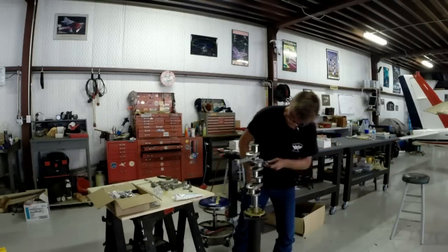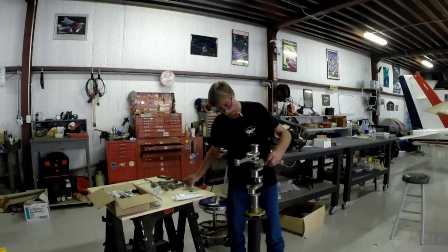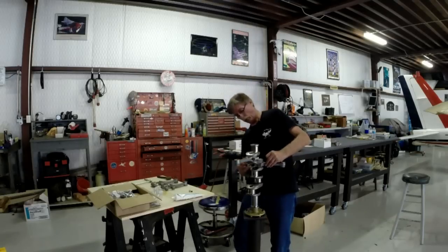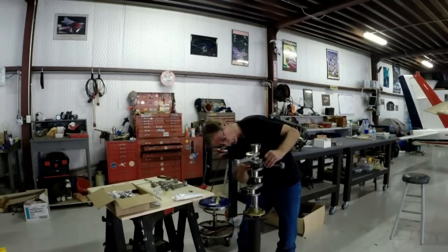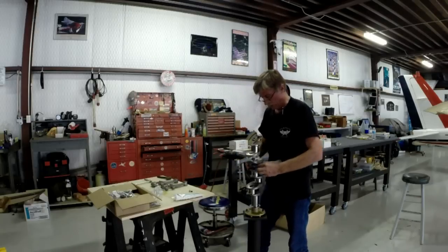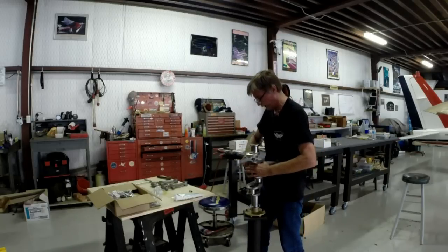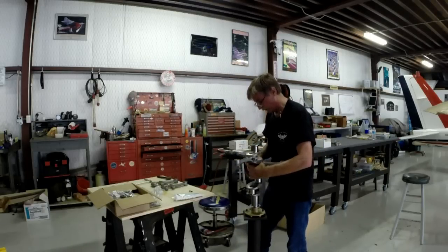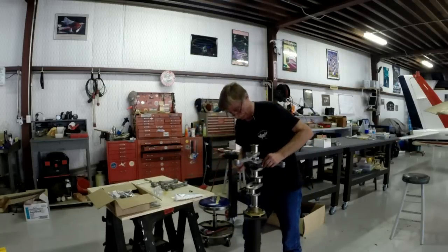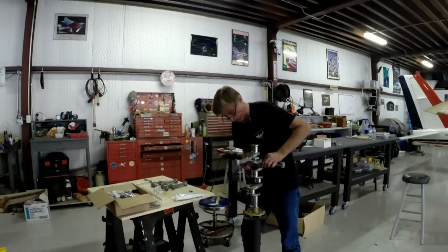1-1. This is 2. And 2, making sure all the cap ends line up. Like I said, those numbers are on that side for a reason. Now I'll try to cinch this together. If not, I'll have to persuade it a little bit with my hammer. That, by the way, is made out of a chunk of brass.